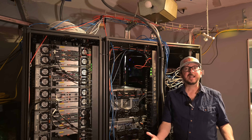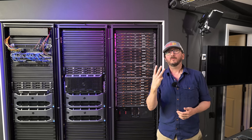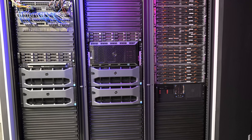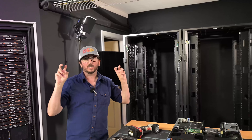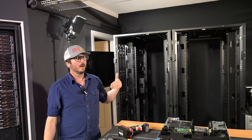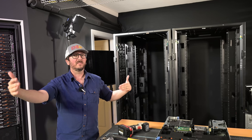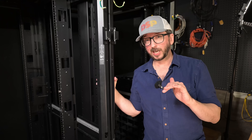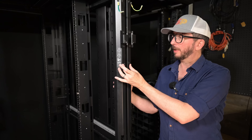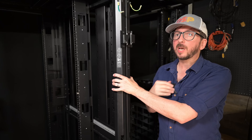If you've got questions, drop them below. Now, if you're going to build something like this — well suited for three 42U racks — most 42U racks are going to be almost exactly the same height and width, but some can be wider. These are the APC NetShelters. I love these things. I've got a 3150 here and a 3350 here — one will be used for networking and general purpose compute, the other for its depth, which is really good with the 3350, very deep. Another thing to consider if you're getting more than one rack is baying options. Some will have internal baying mechanisms that you screw through to actually tighten them together, which is pretty common.